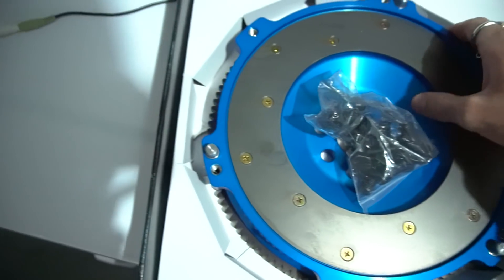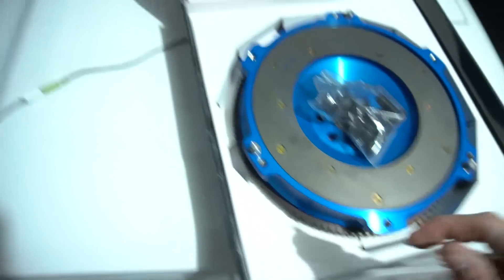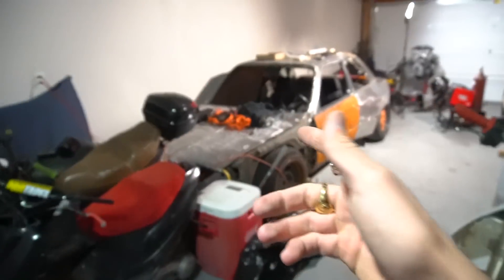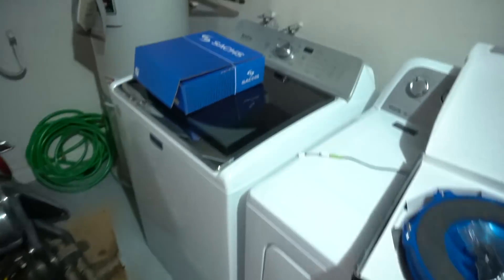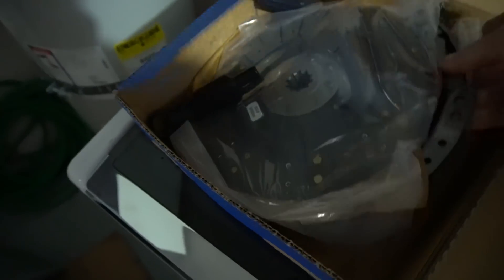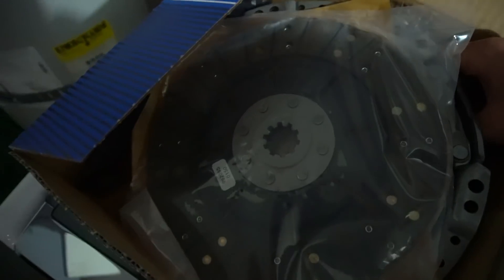Here's the lightweight flywheel I went with — it's a 10-pound aluminum flywheel, so we're cutting off 10 pounds. It's still decently heavy but flywheels are always going to be somewhat heavy. For the clutch, I went with the Sachs clutch — it's what Daniel runs on his M3 motor and it's held up pretty good for him. It's a springless clutch with a pressure plate and a new throw-out bearing.